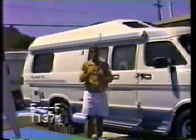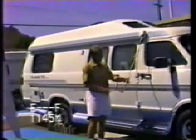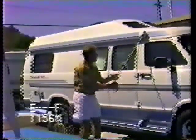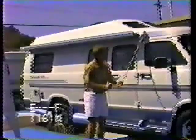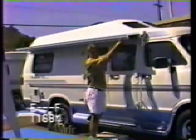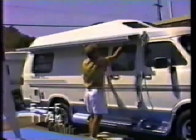Now let's talk about the awning. Inside in the toilet area, right next to the toilet, you'll find this little rod with a hook. Put the hook into the little eye right here. It has a handle on either end — this one spins, so flip it down so you can turn it. Pull it downward so you're creating downward pressure; otherwise it flops around. Start turning your awning and bring it out about a foot. Once the awning is out about a foot, reach inside and loosen the knobs — it's got an elbow, bend the elbow out.